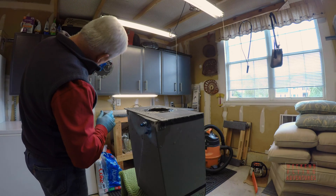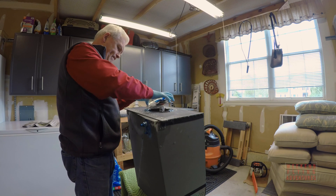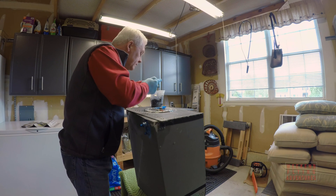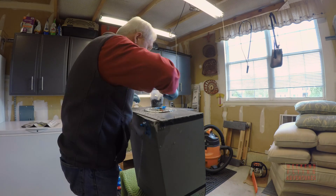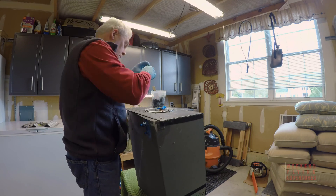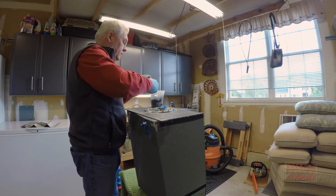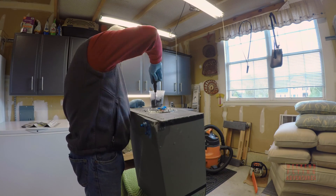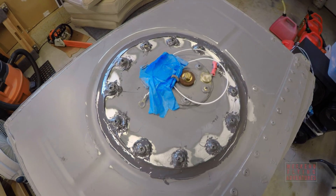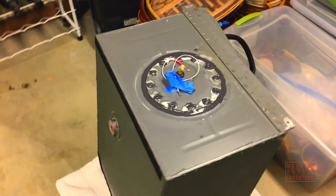You need to spread the sealant on all the surfaces that need to be sealed. It spreads like peanut butter — not too difficult. I use gloves and try to be very careful not to make too much of a mess. The panel is held to the front of the tank with a series of screws that go into nut plates, so you dip each screw into the sealant and put them in. I put extra sealant around the screws themselves because I think that might have been how the fuel was leaking out before.